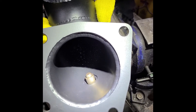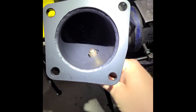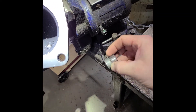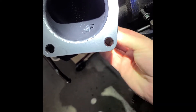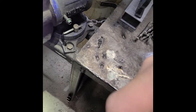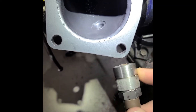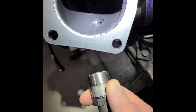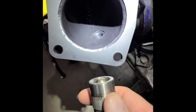Exhaust needs to flow over that sensor in order for it to read correctly. So I'm going to pull this sensor out and put one of these extenders on. I've mocked one up right here — it's a little one inch extender, double threaded. I'm just going to set it on here. Now what I want you to pay attention to as I screw this on — where's the tip of that sensor? This is only about an inch and a quarter to inch and a half extender overall, and I've seen extenders that are almost two inches long. That I really am not going to trust.